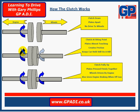The next diagram shows us the rotating plate joined to the engine just starts to take up contact with the one connected to the wheels, because what we've done is brought the clutch about halfway up. That's what's called the biting point — you've probably heard of the biting point. Before the plates are fully together, they're almost touching, and what that's doing is creating a friction.